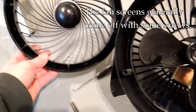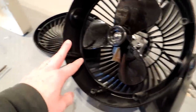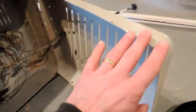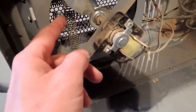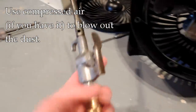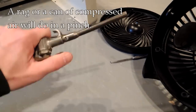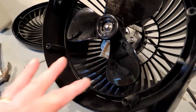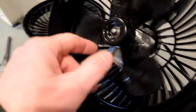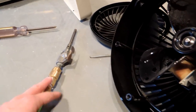If you want to keep these things going, first get the thing apart. Most of these are put together with Phillips screws, sometimes Torx, but in this case it was Phillips screws. I get the cover off — on this heater I just remove the back cover. This one hasn't been touched yet and it's full of sawdust from the shop, all caked with dirt. The first thing to do is blow that out with compressed air using a blower gun. If you don't have that, you can wipe it or use an aerosol spray designed for computers, but compressed air is definitely the easiest.